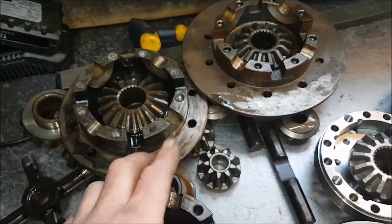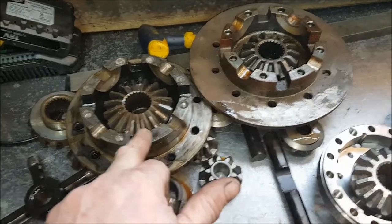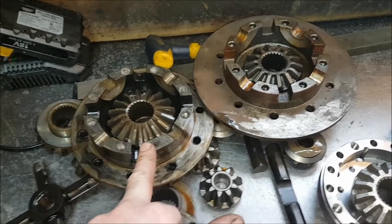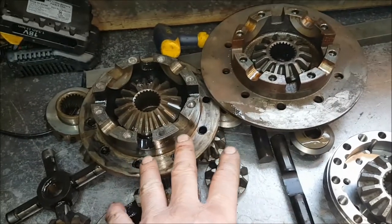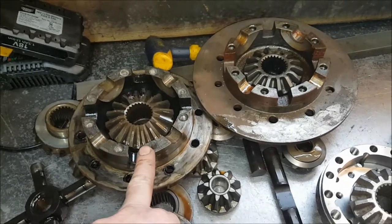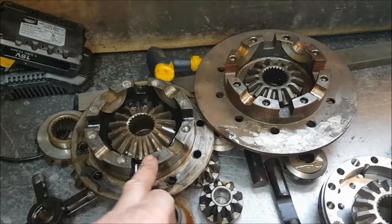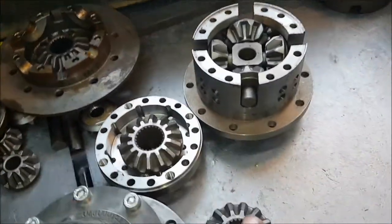So that's a unit that's actually now going out of favour because they're becoming more difficult to find, because these are also fitted to TD5 110 rear axles, and those are beginning to fall apart, so they're being rebuilt. And quite often, if it's something like this that's snapped inside, the whole unit's broken. So we don't actually machine these anymore unless they're to order. We actually now build short nose P38 diffs in short nose casings, and we also peg them as well, and we can change ring gears and make them stronger. But that's another video.